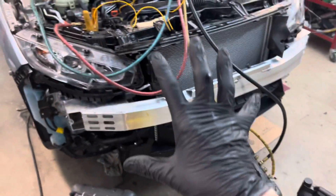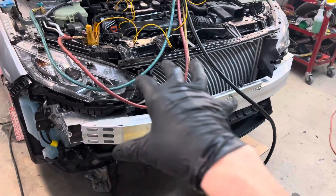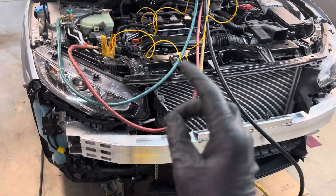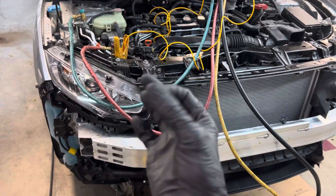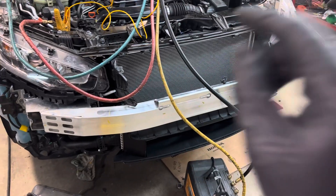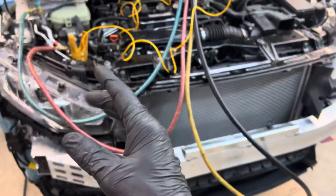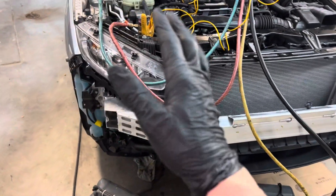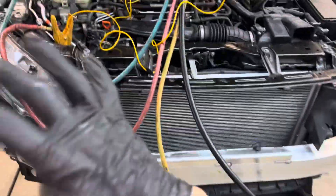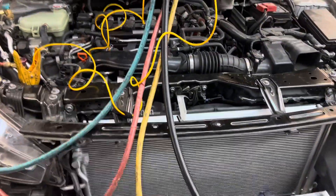It's about time to draw the vacuum on this Honda. This is about the fourth video — several days ago I made a video about this. Today is the second video. The first video I just charged it up with three ounces of refrigerant, just enough because we're trying to reseat the front shaft seal in the compressor. We're going to see together whether this shaft seal holds or not under vacuum. The problem was it could not hold the vacuum — it was roughly 15 or 17, from several days ago. It was a low vacuum; it just could not hold, pull a vacuum.